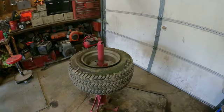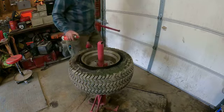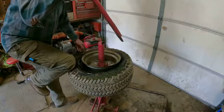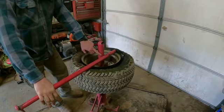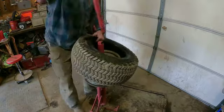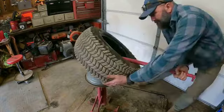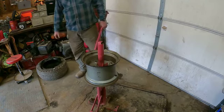Okay, so what I like to do - you get these old tires, they're kind of hard - I'll just spray a little lube in there, just something to help it out. Anyway, you take this end - it's got the flat part - push the tire down on one side. All right, so you got your lip started. You go on one side of this, that tire's off. Now when you're doing the lower bead, same thing - you don't have to flip it over, you pick the tire up. Now I'm in the lower bead, and I've just banged that tire right off. It's that quick.